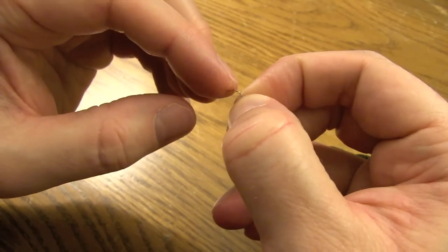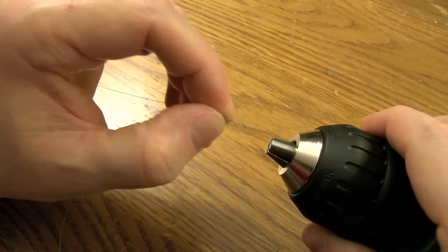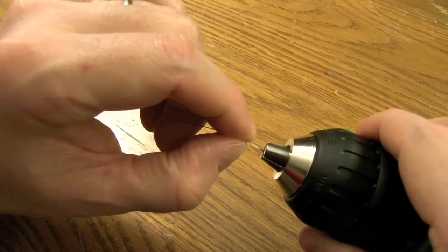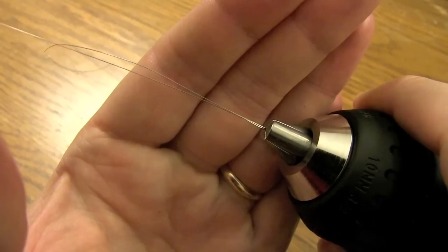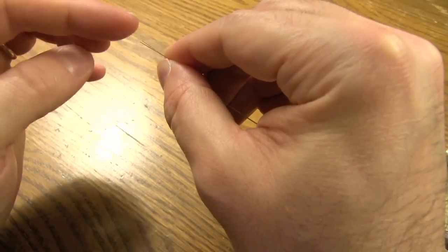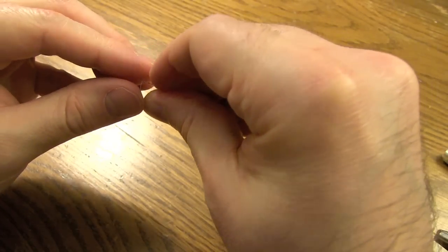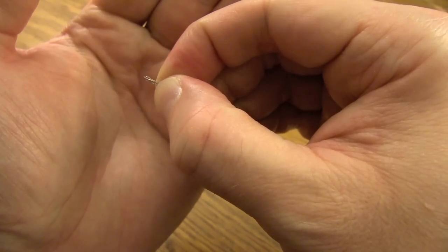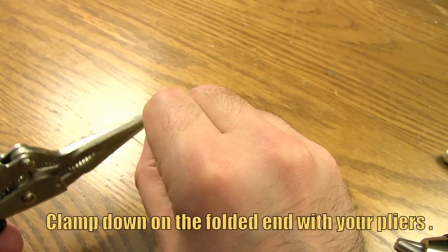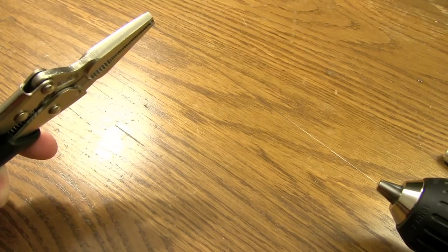Then the next step, I'm just gonna fold that twist. Next step, I'm gonna insert that manually folded twist into the four clamps in the drill, and tighten down these four clamps on that manual fold. Next step, I'm gonna take the slack out of both of the wires. Then I'm gonna manually fold these two ends, keeping the tension. Once I've manually twisted those ends, I fold it over just like that.